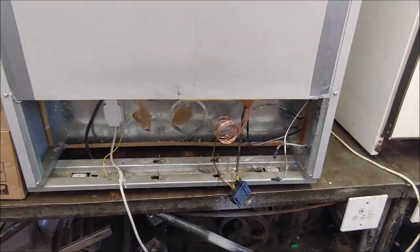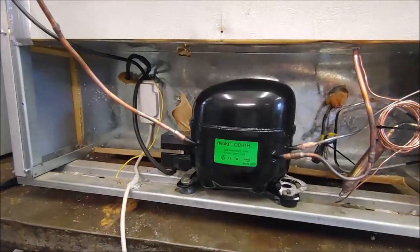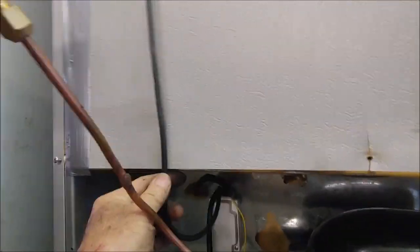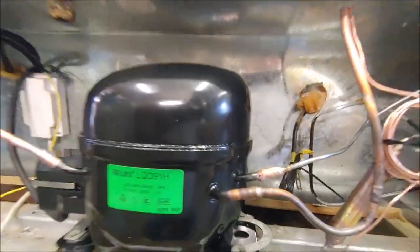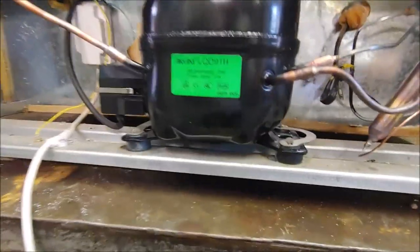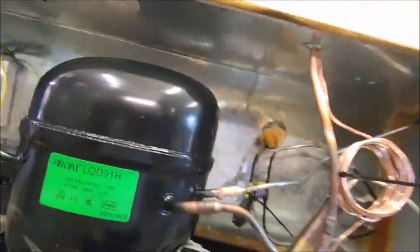The back cover is on now — I used a little bit of duct tape to tape the back piece in. Now I can install the compressor — there's my compressor in the box ready to go in. The compressor is in and it's running. The new suction comes from the hole we made from the inside — the old suction was there but it's chopped off. I'm using the existing high side and this is the capillary. There was a solenoid valve with two capillaries — I've just disconnected the two wires and tied them up with a zip tie so they don't make a short.